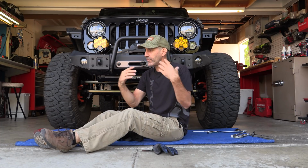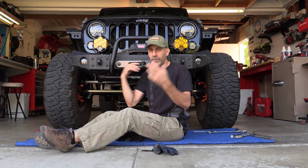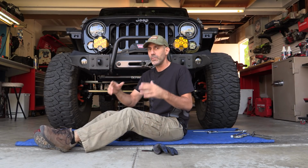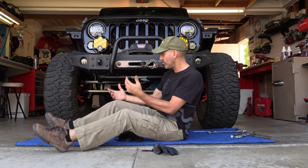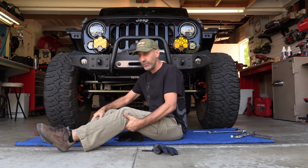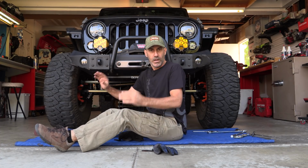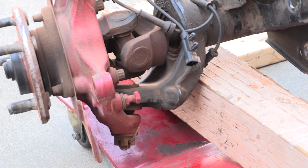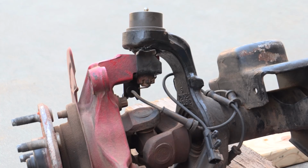So what I decided to do is I want to share with you guys the frustrations and the realness of this. You know, it's easy to just kind of figure it out and then button this up in the video, but here's what you do. Death wobble is a mysterious thing that happens to us Jeepers. The one other time I had it before was when the lower ball joint on the C's went bad on the steering knuckles, the stock ones, which is a normal wear item. Replaced them, solved it. It could be a lot of things.